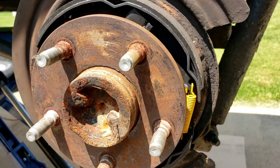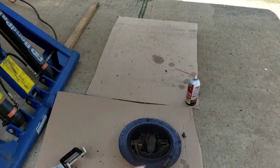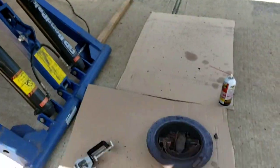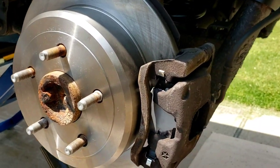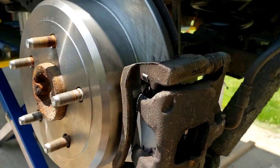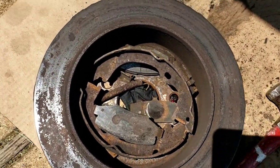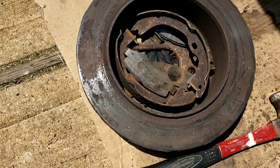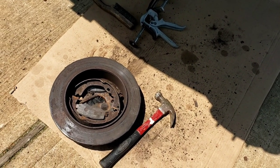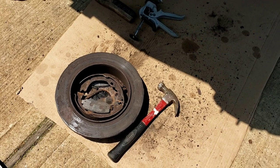The shoes are in - I sprayed everything with brake cleaner, just going to clean this up a little bit and then it's rotor time, put back the rest of the brakes. I showed you the full rear brake job in my other Wrangler video, so I'm not going to duplicate it here - but I'll say it quickly after I put a majority of this back together. Loosen up the frozen pin, lube it up, give it a little sand, grease it all up. There's all the old parts - the brake shoe, the brake pads, and the crappy rotor. Off to the other side. If you want to know how to do the brakes, I have a separate video for the Wrangler brakes - this one was basically just to get to the parking brake. Thanks for watching.